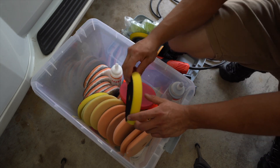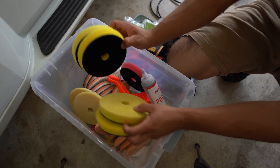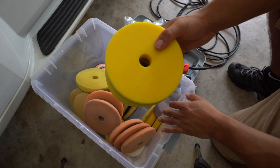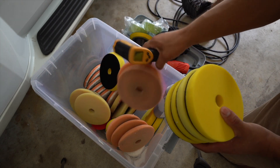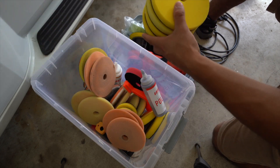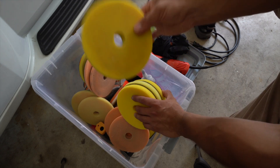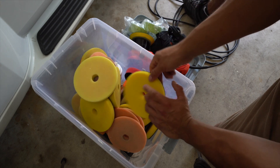For starters, all these will be linked below. Depending on the size of your vehicle, a good starting point is just four polishing pads to get through the entire vehicle. Four might not sound like a lot if you've seen other detailers' setups, but it's plenty. You can do roughly one pad per panel — one pad for a door panel, switch to the next pad for another door, then the hood and front fenders, then the roof.